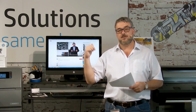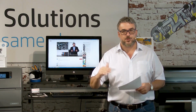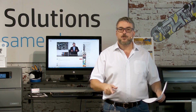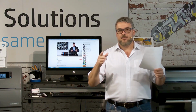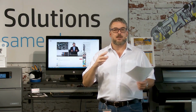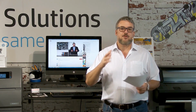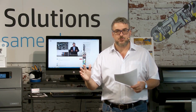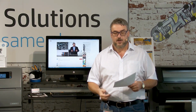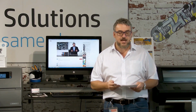If it's on the media locator and you're having issues with the preset, then call HP 1-800 support and say, I loaded a paper, it's certified, I ran the certified mode, I pressed play, and it's buckling or cockling. We'll look at things that might be on the periphery of your issue, like, say, a temperature issue or a high humidity or some other variable, and try to isolate it, but we'll take responsibility for that, because we've looked at that paper. Okay? Just some general outlines on paper issues.